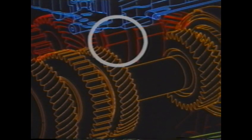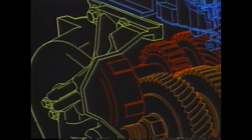In any other range, the sleeve moves toward the second driven gear to allow forward motion of the vehicle. The second reverse clutch is located on the input shaft and is part of the second reverse and third clutch housing. Its main components are a housing, a piston, a return spring assembly, a clutch pack, and the second reverse speed drive gear. The first speed clutch is on the input shaft just inside the rear cover. Main components are a housing, a piston, a return spring assembly, a clutch pack, and the first speed drive gear. First gear is applied in all forward ranges and speeds.